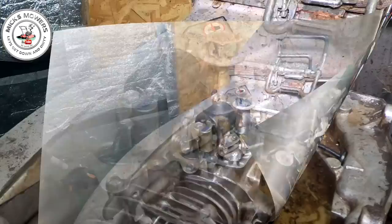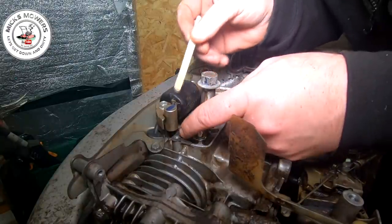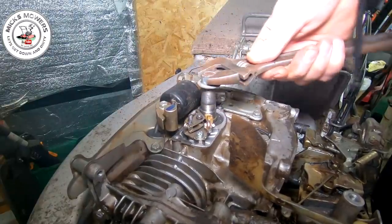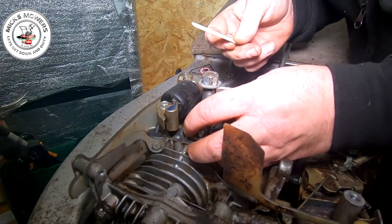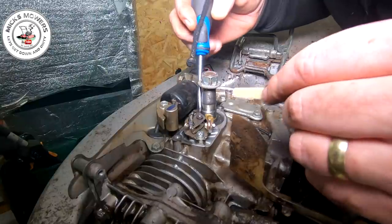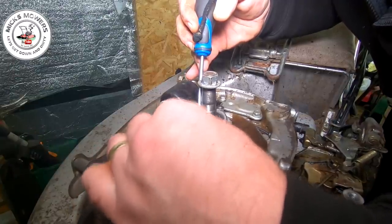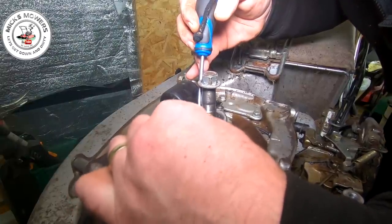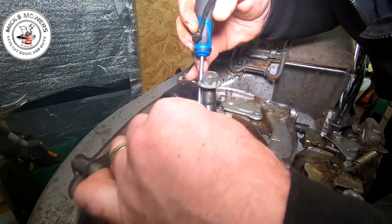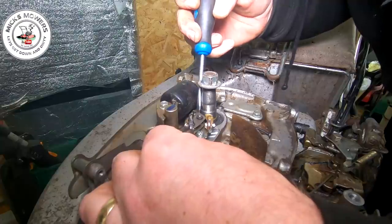I've got an emery board here for doing nails — all I'm going to do is get inside here and maybe turn the crankshaft a smidge to give me more opening — that'll be in the closed position. I'll get a screwdriver to pry open the back of the points — there you go — pry the back of the points and then I can get my emery board in and just literally re-face these points. All I'm doing is tidying them up, getting rid of any high edges and any pitting. You can see all that oil coming off — that will aid in the points failing when you get to a certain point. Snap that bit of emery board off, open them back up and go back in there again.